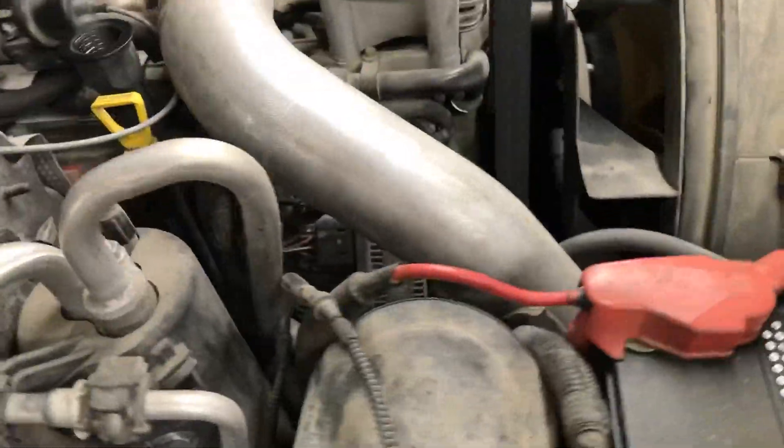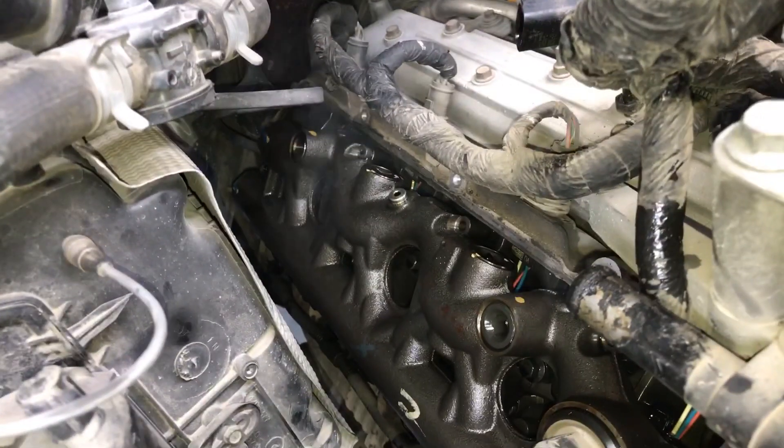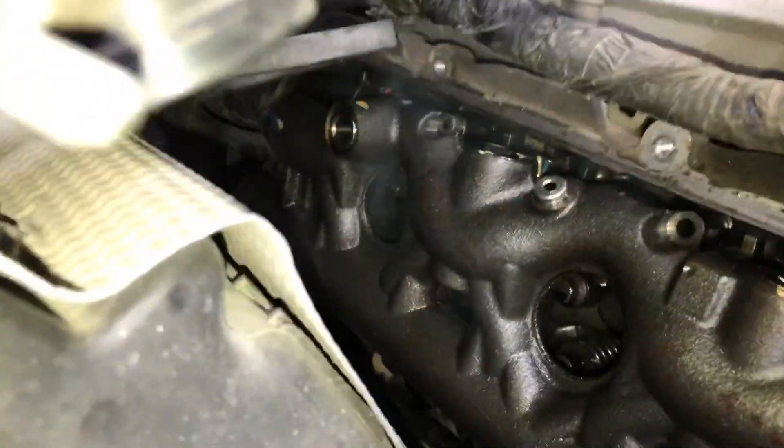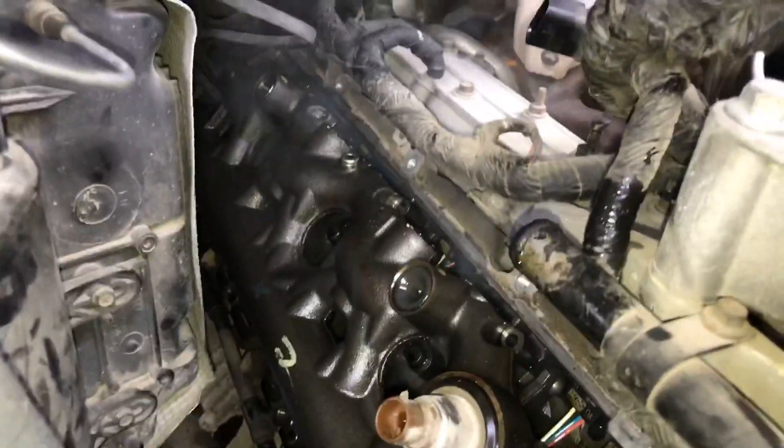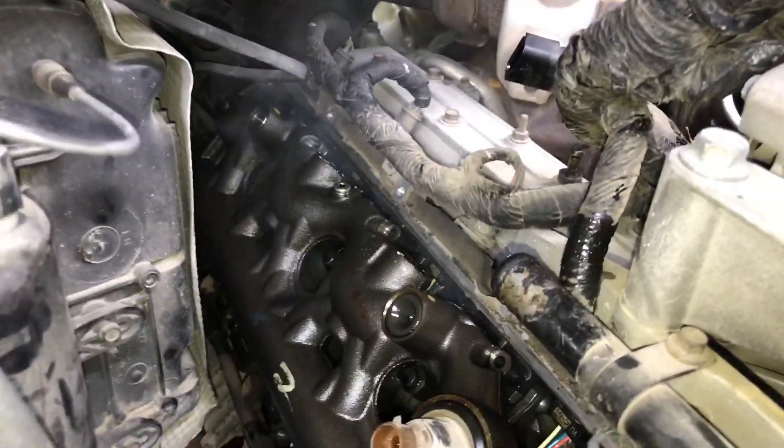All right, let's check this side. That was quick, that was magic. Let's plug it back and see what we see. Okay, it does not look like it's the top injector O-rings. We've had broken stand pipes before — let's just hope it's not the path of resistance and we're hearing it over here because of an STC fitting, because it has an EGR cooler on it.